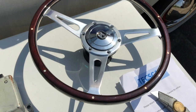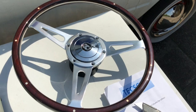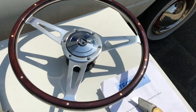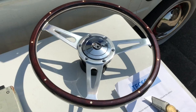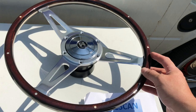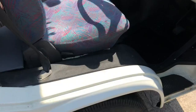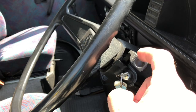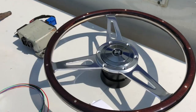This new wheel is 15 inches, so if I was fitting it without power steering it would be much worse. Going to power steering, 15 inches is a more sensible size — still very large — but it also gives you more clearance above your legs, you can move your seat around more, and it doesn't obscure the instruments. A 15-inch semi-dish, where the spokes are cranked just a little bit, is a pretty good idea. You can get a 17-inch flat-spoked version but the flat spokes mean you're constantly catching the stalks.